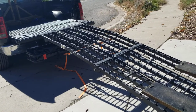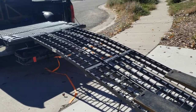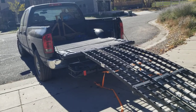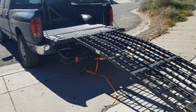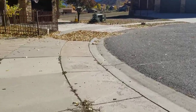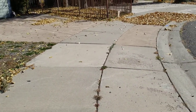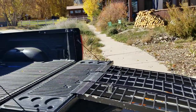I make sure I can get both feet down because the last thing I want is to spring and wind up with the handlebars hitting the door jam on my shop. So I just go real slow and walk it up. If you ever get to a point where you're using a ramp like this and can't find a good place to go up — and you're nervous about going up on the flat because of maybe burning your clutch — sometimes it's easier to find a school or the hotel you're staying at that might have a curb. You can take the ramp, put it up against the curb, hop up on the high ground with your bike going up the ramp, then back your pickup up to that place and only have to go up about eight inches.